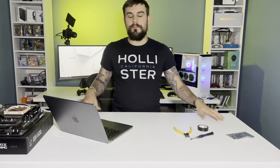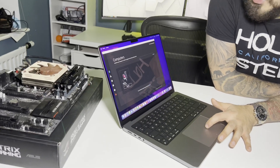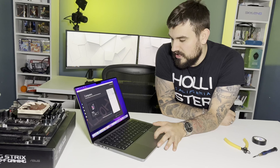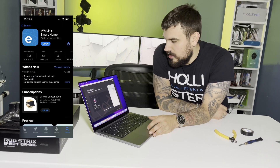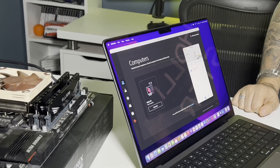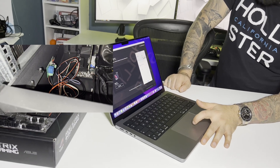I've just installed the Wi-Fi relay into the server downstairs in the little cupboard under the stairs. As you can see now on my laptop — on the MacBook Pro — I've got Parsec open. I've got my PC, which is this machine here, but the server's currently switched off. The good thing about M1-based Macs is that you can download iOS and iPadOS apps, so this is the app used to pair the device and control the relay. I will power on by clicking that. It does a momentary switch and turns back off because it only needs to be pushed. Whilst that's booting up — it takes a little while because it's an X99 board and it power cycles after doing some checks — I'll talk about the pairing process, because it was one of the challenging points of this smart relay.